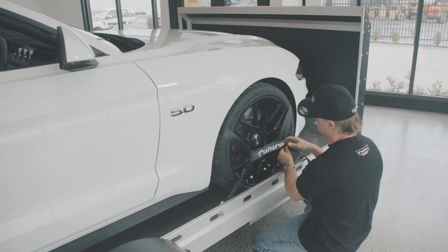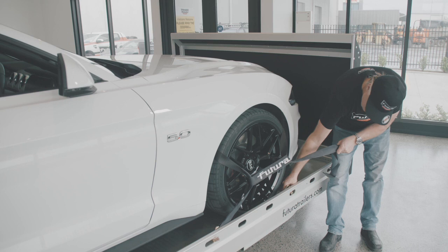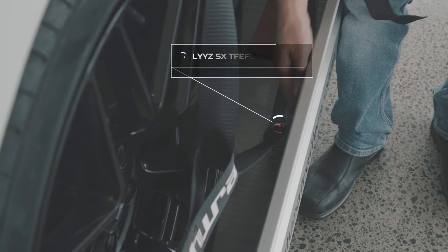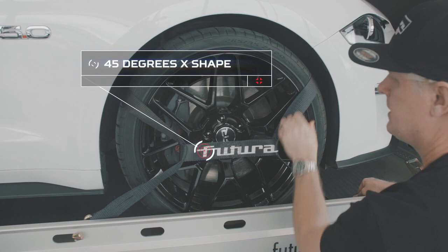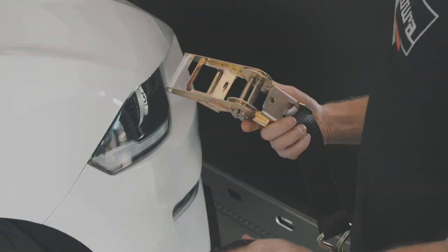It's roughly positioned where I want it. I'm going to add a floating hook — a hook which could either go in the slot or I'm going to use the airline track fitting because this is a super sport trailer and it has airline track on it. I'm going to position that just in front of the tyre. The beauty of the hook being positioned away from the ratchet is we can create this 45-degree X shape and position the tie-downs in the best way to suit the wheel.